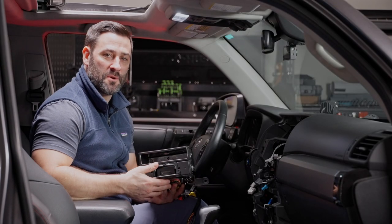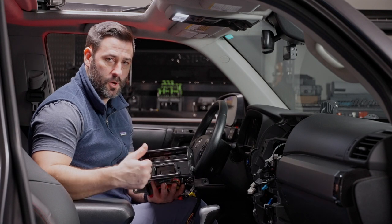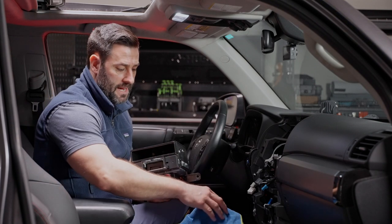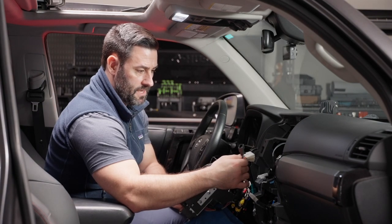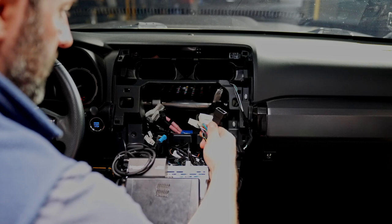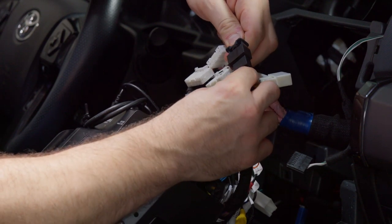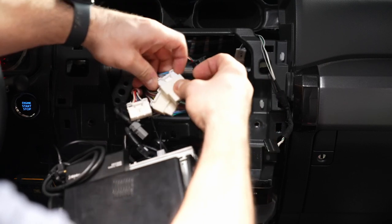It's go time — time to put in the Sony 9500ES in your Toyota 4Runner. The 10.1-inch HD touchscreen comes detached from the body of the bundle by design. We're going to put in the body of the bundle first, then put over the dash kit, then put the screen on top. Put the microfiber back over the shift knob since we'll rest the new bundle on that while making connections. We're going to start with our main vehicle connectors — for this 2020, the plugs are these three right here. Matching black to black, that plugs right into position, and then the second and third connectors. Those are the main connectors for this 2020 Toyota 4Runner.